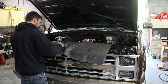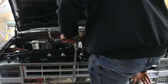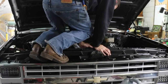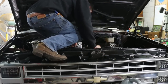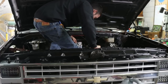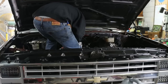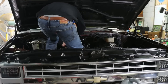And I guess it's getting towards the end. I didn't show the engine oil that I put in this thing. What I'm running is about as cheap an engine oil as I could possibly find. Just a 10W30. You could probably use a straight 30 and it would be fine. But I'm using a non-synthetic 10W30 from O'Reilly's, because I don't think it's the best idea to run an awesome oil in a brand new engine, because you actually do want it to wear in some.